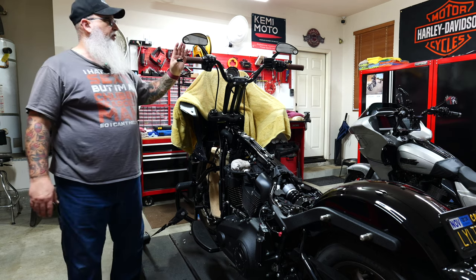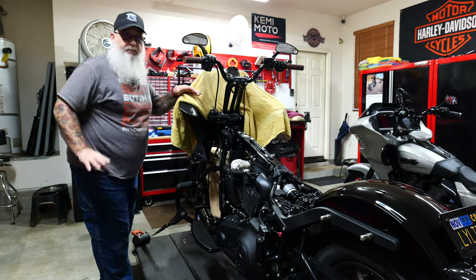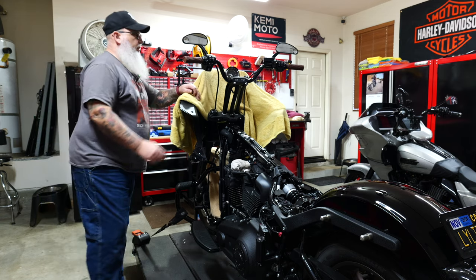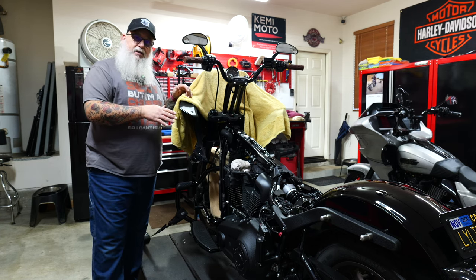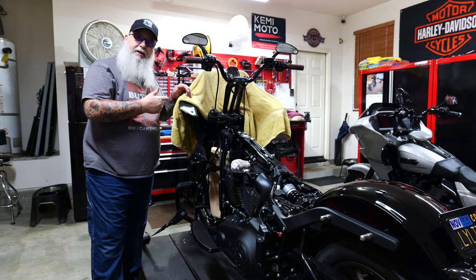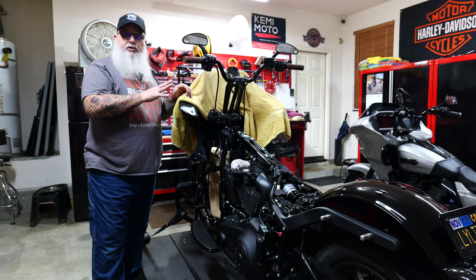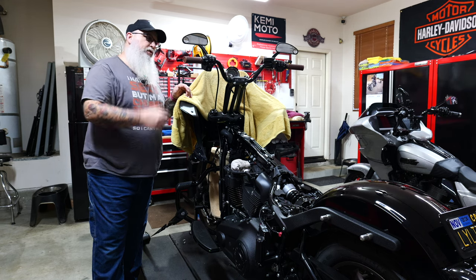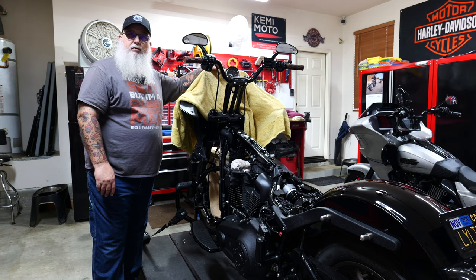Now we've got everything put back in place — all these parts on, the gauge reinstalled, wires all connected down here in the boot and got them put back in. Definite lifesaver by pulling those guys off to get that thing tucked in there and get those wires bundled in. I used a wire loom to clean it up and make it look real good. Now we're going to put the tank back on, the seat, get it all connected, and then turn the switch on and let this gauge acclimate to the bike. All your mileage and everything else is stored in the ECM, so when you put this gauge on it'll turn on, it'll sync, and it should adopt the mileage. We'll get it all assembled, sit on it, show riding position, and crank this thing on to see what it looks like with the gauge relocation from the bar clamp to up front with the new Thrash-In bar.